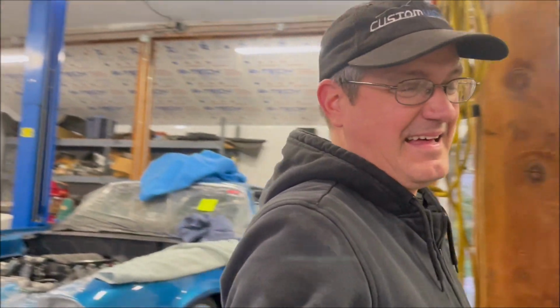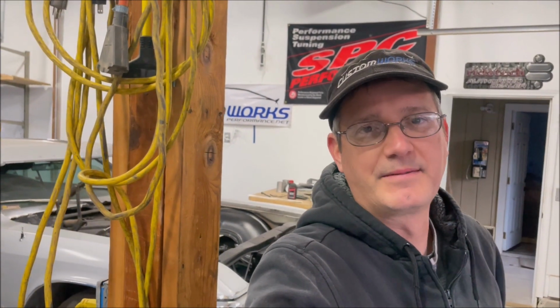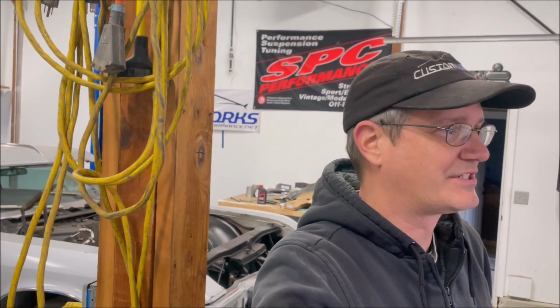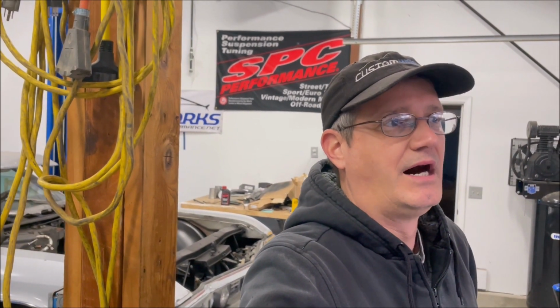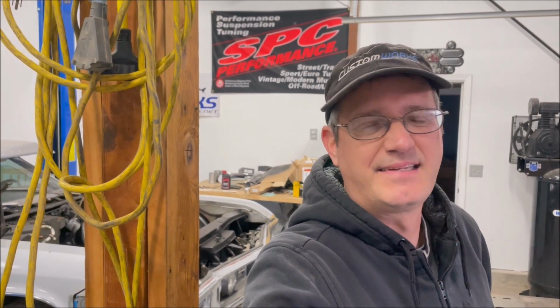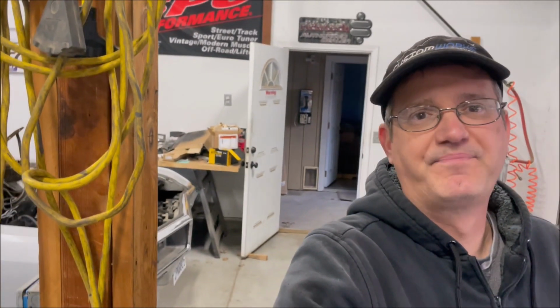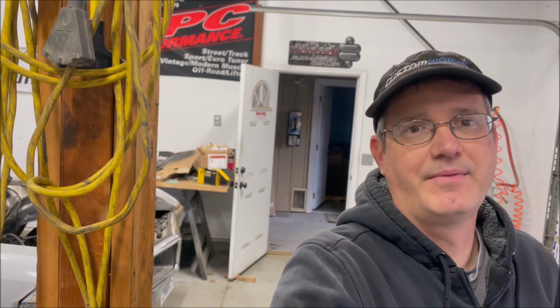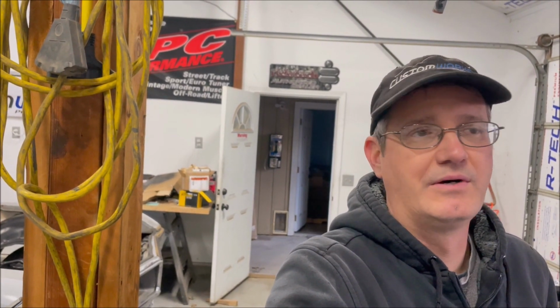I'd recommend trying those things. They're kind of easy fixes. I'm really on the fence with the Holley Sniper. I think the design's good. As for some of the components in there, the O2 sensors, the IAC motors, the TPS, if you start getting some weird things, go out and buy genuine Bosch units. Go buy good Standard Motor Products IAC or TPS. I think that'll eliminate the problems. If you go on Amazon and buy the $24 IAC motor, it's a piece of junk. If you buy the one from Holley, I think they're buying the same junk that's on Amazon or wherever you're buying it from, like AutoZone.